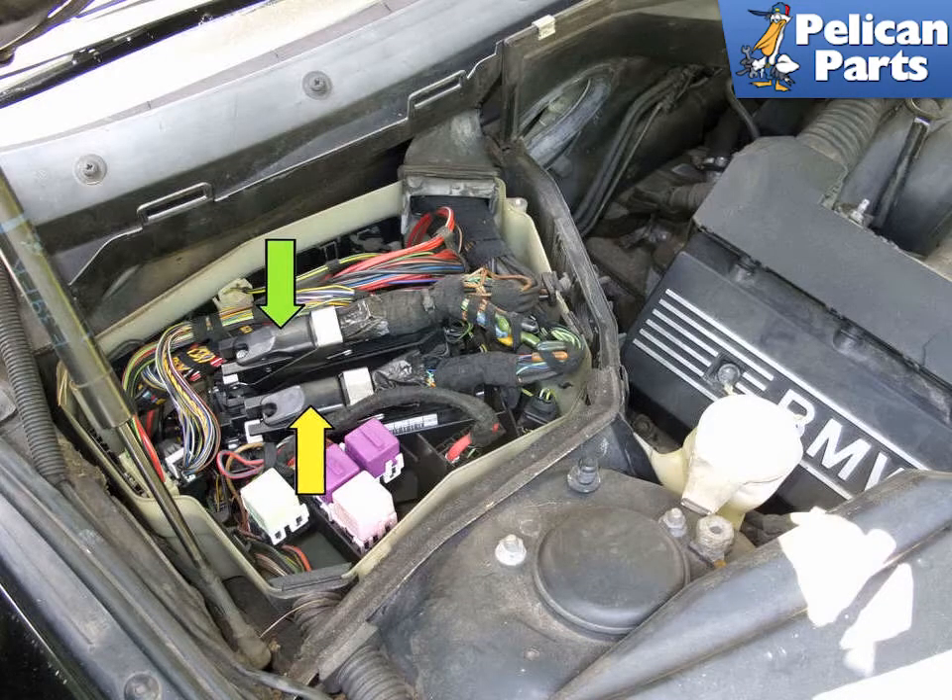This video is to help you have a better understanding of your BMW E39 engine. The engine control module is mounted in the electronics box at the right rear of the engine compartment, underneath the interior ventilation filter housing. In the MS42 and MS43 cars, the ECM is flash programmable to boost certain performance parameters, such as allowing for higher top RPM or increased low-end torque.